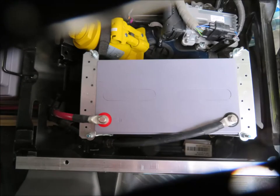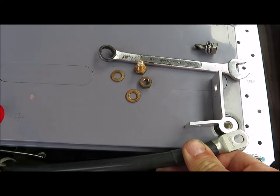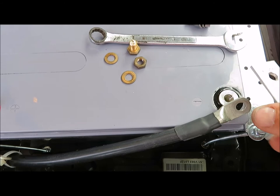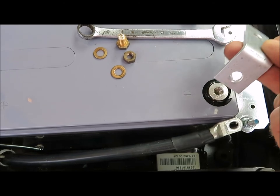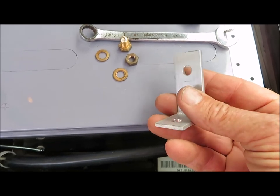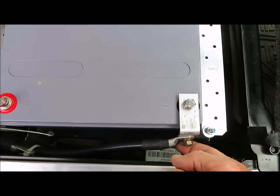This is how it looked with all the cables connected. There was just one more complication, however. After I hooked up the cables and put the seat back in, I discovered that the negative terminal was just slightly too high and the seat wouldn't slide all the way forward. To get around this, I fabricated an aluminum bracket that bolted onto the negative terminal and allowed me to connect the negative battery cable to the side of the battery. The bracket had to be beefy enough to carry the maximum battery current. I used a short section of 1/4 inch aluminum, 1 inch wide. This has a current carrying capacity of 308 amps. Since the batteries are fused with a 150 amp fuse, the bracket should be more than adequate.